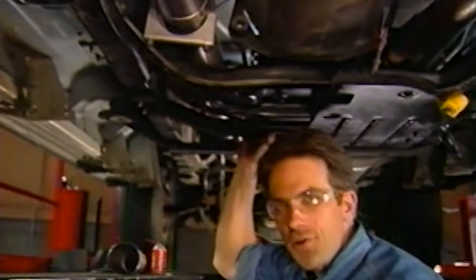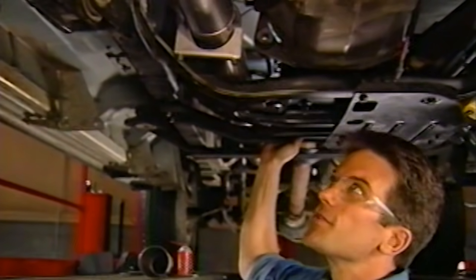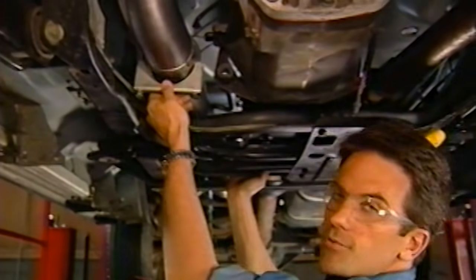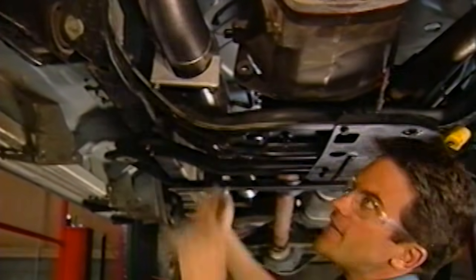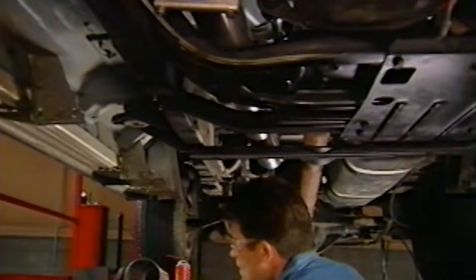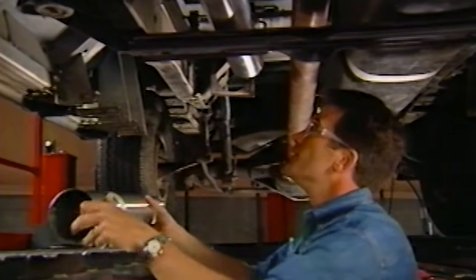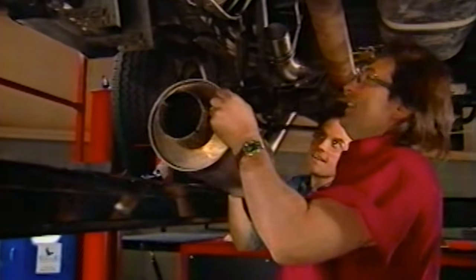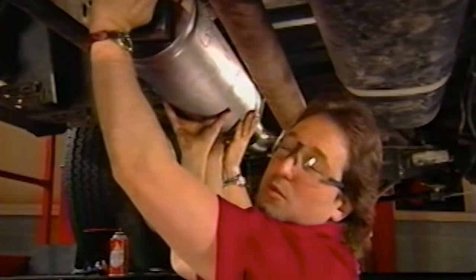While Stace was putting our modified turbo on, I went ahead and got started on the exhaust system. First thing I did was put on a new outlet pipe, then got a 4-inch clamp loosely in place so I could slide the intermediate pipe on. For you guys with extended cabs, the kit also includes an extension pipe. Now it's time for the muffler. Here you go. Got it. The kit comes with special hanger clamps that slide right into the factory rubber mounts.